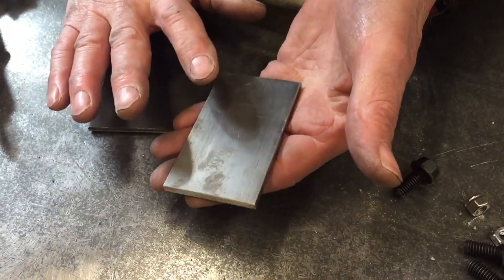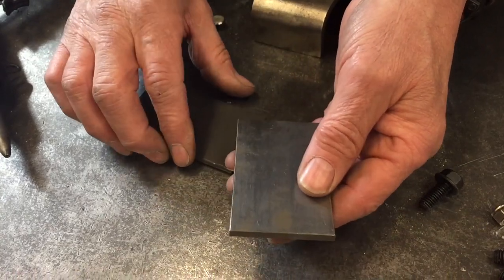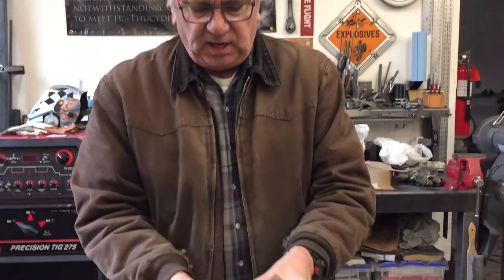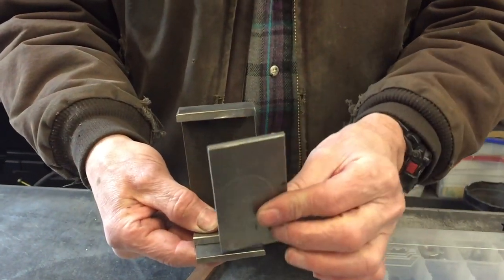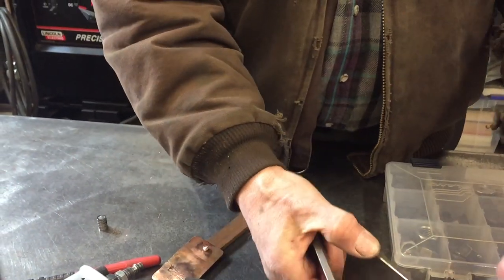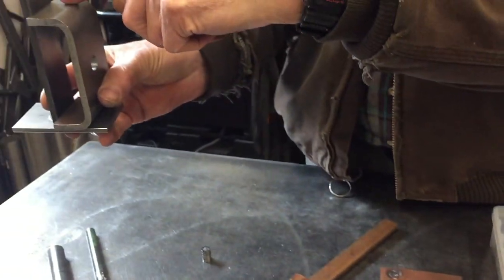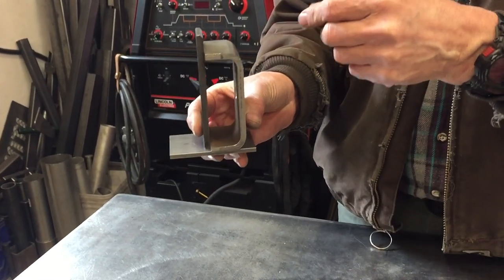So when you're getting your steel for your boxing plates, here's what I did: I measured my frame from one end to the other — it was about seven and something inches at the back and narrower at the front. I went to the steel place and said I need a piece of pickled and oiled 3/16" steel, sheared to seven and a half inches wide by eight feet long. I brought those pieces home, clamped scrap pieces on the bottom, rested my boxing plate on top, marked it with a sharpie, trimmed off the excess with a grinder, cut-off wheel, or hacksaw.